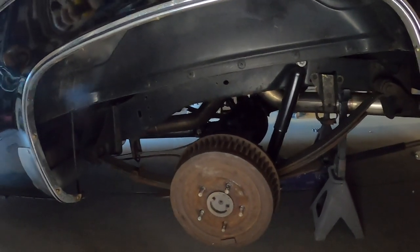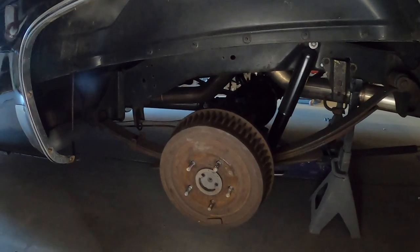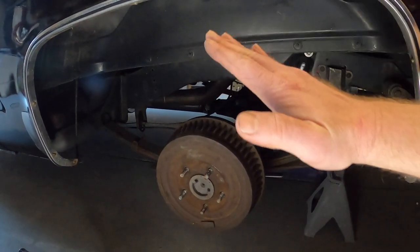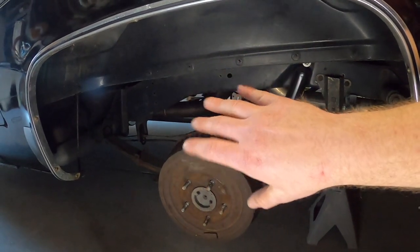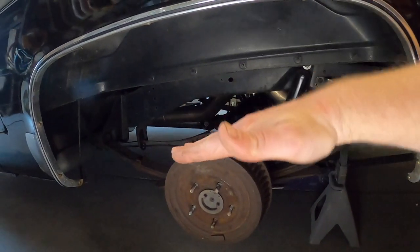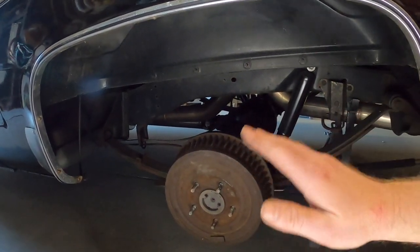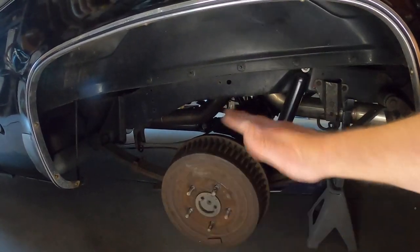Well, let's say for instance you got a couple cuties outside of the local Dairy Queen and you want to lay a set of 11s for them, show them what's up. You let on the clutch quick, the pinion hops, or juts up quickly, right? The tire goes forward, starts to lose traction. The next thing you know, this leaf spring is just walking around trying to grab traction, and it's what they call axle wrap or wheel hop. So the tire's trying to go this way, the pinion's trying to go through the bed, it's no bueno.